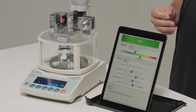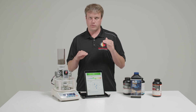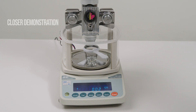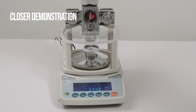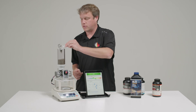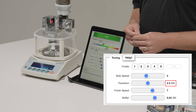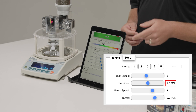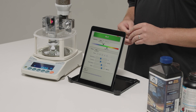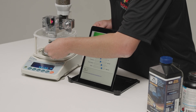The transition was too late. When it transitioned, the small tube started at a very low speed because it transitioned too close to the target, so something is not perfectly correct with this one. Even though it finished on the right value, it won't be efficient if we leave it like this. So we're going to change the transition so it transitions sooner. The 2.5 might have been a little much, so let's go back to 2 and try to optimize that a little bit.